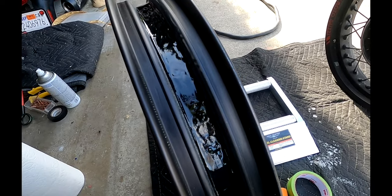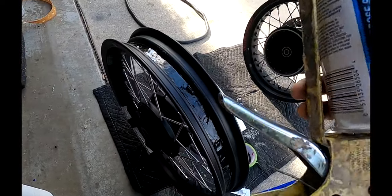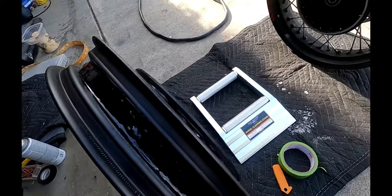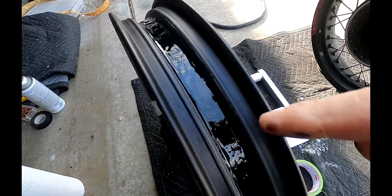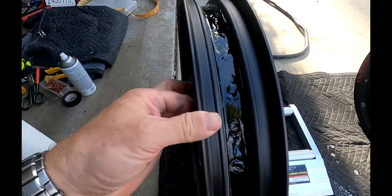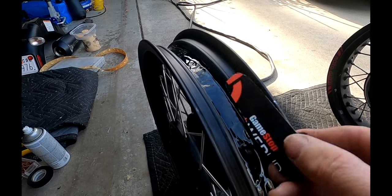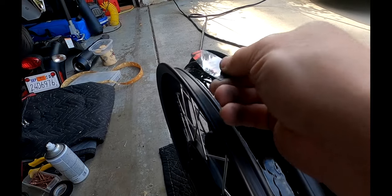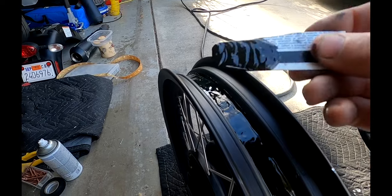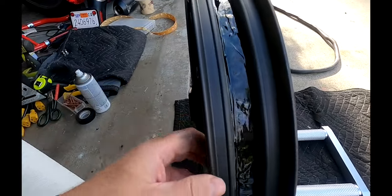Both wheels have been done. I used about two-thirds of one tube to do both rims. Squirt it all the way along and all the way around to fill the holes, then go back with another bead. I took an old credit card, cut it to fit the channel of the bead, and used it like a putty knife — lightly pressed and pulled it all the way around. That pushed the sealant into the holes and gave me a really nice smooth finish, like a giant rubber band.